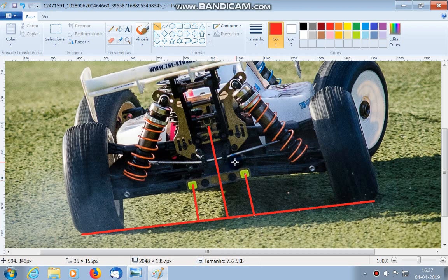Why does that happen? Two reasons, which my way of setup fixes most of. First, springs and roll bars might be too stiff, so the car isn't compressing from the load that is transferred to the outside tires. But as load is transferred, this side extends because it is too stiff for the load it has to carry. So the fix would be choosing springs that are only enough to carry the weight of the car.